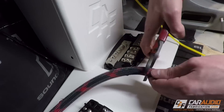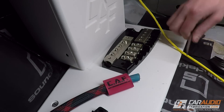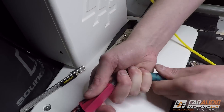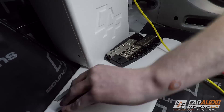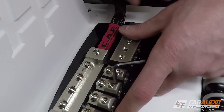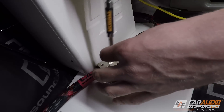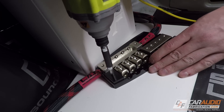Here in the vehicle, I need to start connecting the power distribution wiring. This system is going to include a secondary battery that I need to wire up. The wire that I'm currently working with comes from the front of the vehicle, and I need to add a ferrule and then secure it into the fuse holder. On the other end of the fuse holder, I'm mounting the wire that goes to the secondary battery. I've intentionally not mounted down the fuse holder yet, to get a feel for how the wiring was going to run within the vehicle, but now I can secure it down to the board.